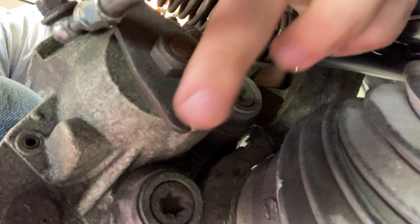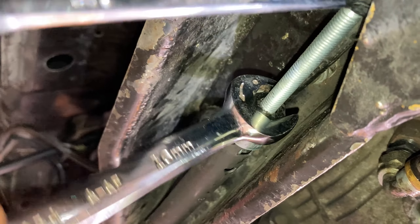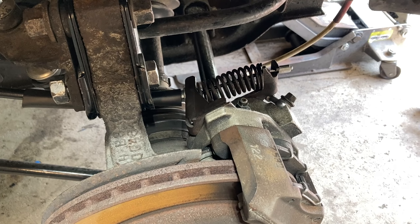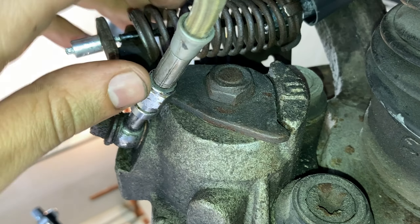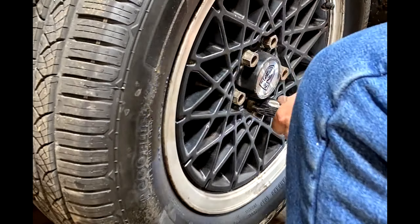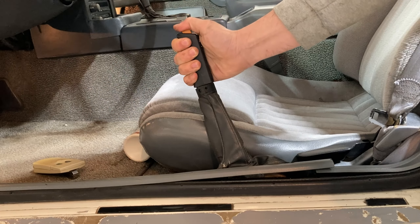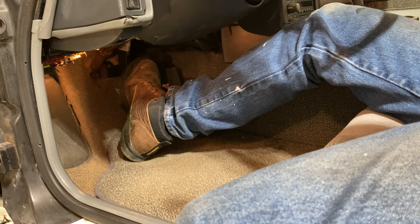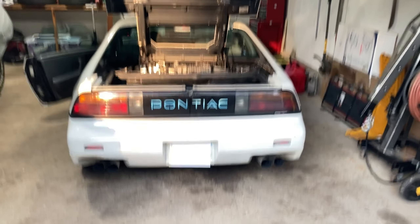If they're not, go ahead and loosen the brake adjuster or check for binding in the cables. Tighten the parking brake adjuster until either the left or the right lever barely stops making contact with the stop. Use a six millimeter wrench on the flat on the threaded rod and a 16 millimeter wrench on the nut. Then loosen it so it goes back to making contact barely with the stop. Go ahead and put the wheels back on, torquing the lug nuts in a star pattern to 100 foot-pounds for aluminum rims. You may have to lower the car partially onto the ground to get this. Then go ahead and test out the parking brake lever to make sure it does not allow the car to move. The parking brake lever should not extend more than six ratchet clicks. Repeat this process as needed. Make sure that the brake pedal is really firm. Lower the car back down to the ground and go for a test drive — take it very slowly and just test it out a little ways. Well that's all for this video. If you liked it please give me a thumbs up, subscribe, hit the notification bell, and check out any parts in the description.